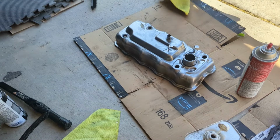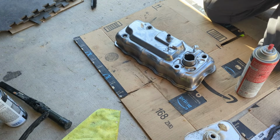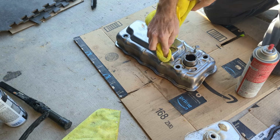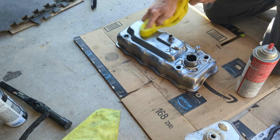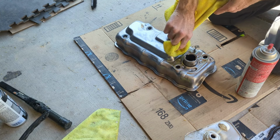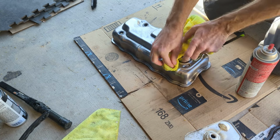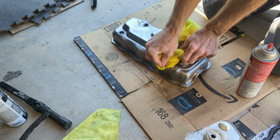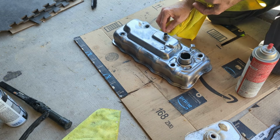Well guys, I did a little research. It sounds like low humidity and high heat can cause it to wrinkle. Can also be caused from not letting the layer underneath completely cure, because it'll be trying to off-gas, especially enamel. It'll escape any way it can, whether you put paint over it or not. It can make pinholes or wrinkle.